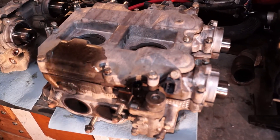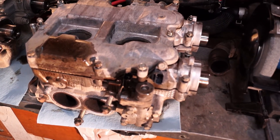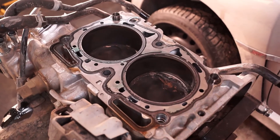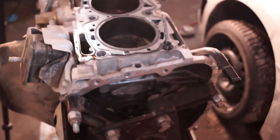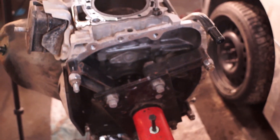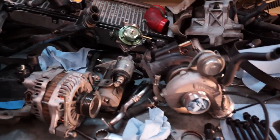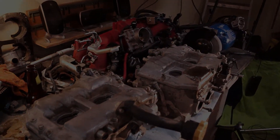Word of caution when you're pulling your heads — make sure they're upright. Because all of your shims, or whatever sits on top of the valves, they'll fall out if it's sitting sideways. So that's basically it. Next video is going to be how to pull the pistons out, split the block, and do all that stuff. And then maybe one day we'll get to reassembly. Try to keep your parts organized — this looks kind of like a mess, but it's an organized mess. It could be a lot worse. Thanks for watching.